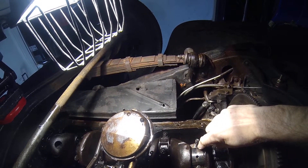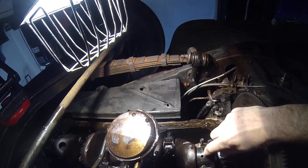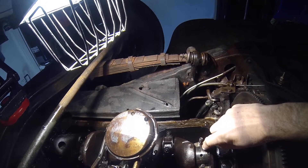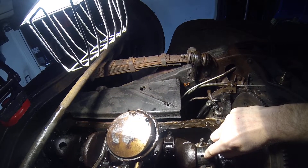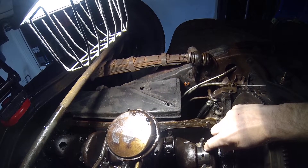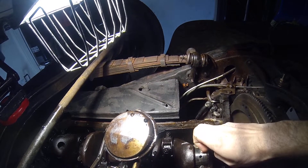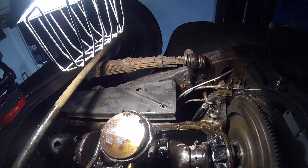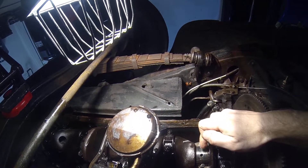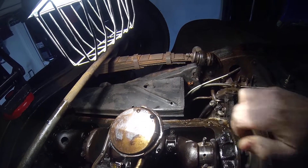I can see some polishing and abrasion here — that's dirt in the oil, maybe some carbon. This engine is fairly clean; there's not a ton of carbon. This would be contaminated oil coming out of the hole, sitting in the bearing, just putting a slight score line there. I can't feel it with my fingernail — it's just a really fine wear line. I suspect all of the bearings are probably going to look like that. It's not too bad; there's no groove there.